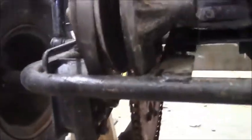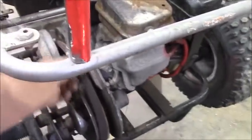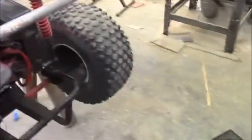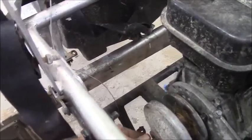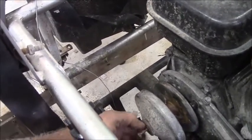I got looking at the chain and couldn't find a master link on either side. So I figured the best way was to first pull the CVT loose from it. All I did was take a pair of tin snips and cut the old belt — that's garbage. Then I took my impact and removed the drive clutch, which I believe was a half inch. These are actually English fine threads. I'll probably save this clutch — maybe I'll give it away at Busco Beach, or get rid of the whole motor there.